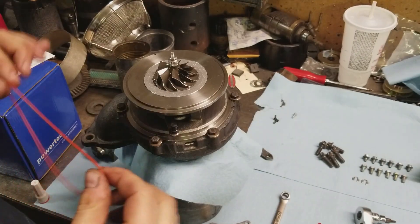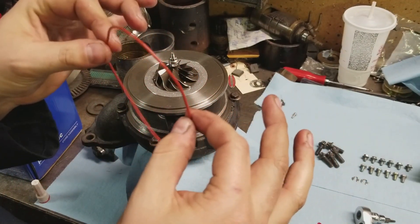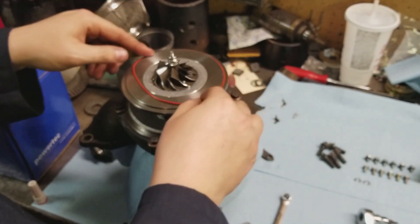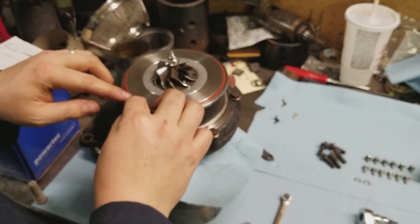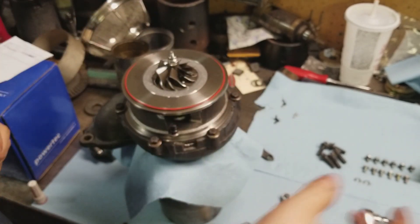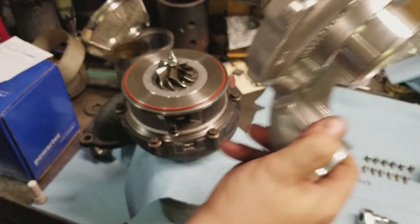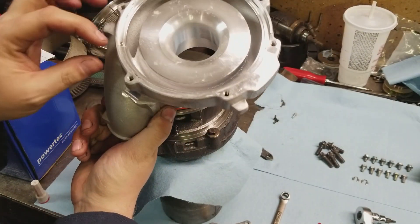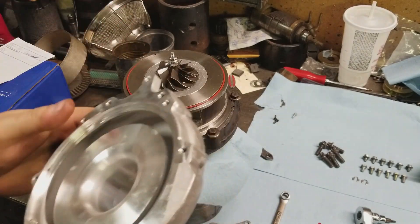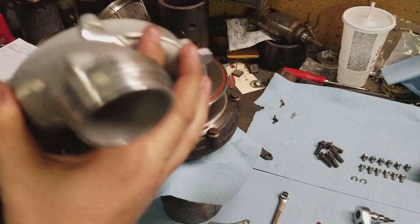Next step in reassembly — the new O-ring. You've got it with the new turbo core or the old one; usually they're still in good condition. You're going to put it right around here just like that. There's no fancy vanes or anything on this side, so you're just going to find out where this is going to clock. On the inside you have a pin that's going to align with the hole you have in the housing over here.